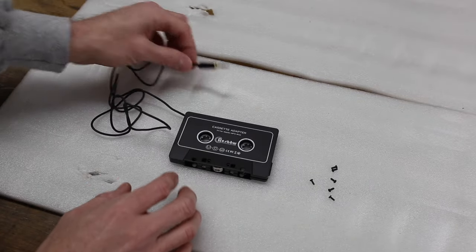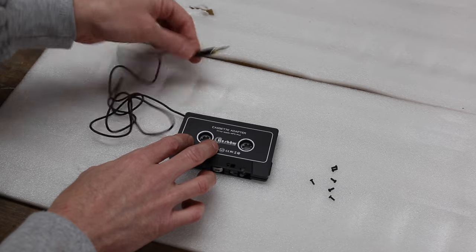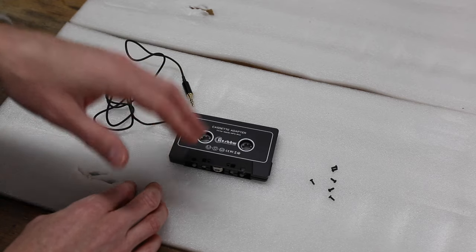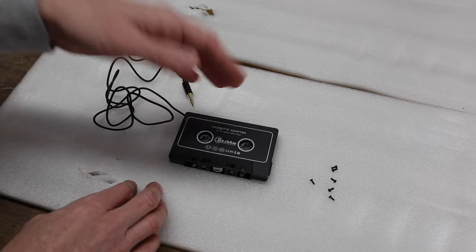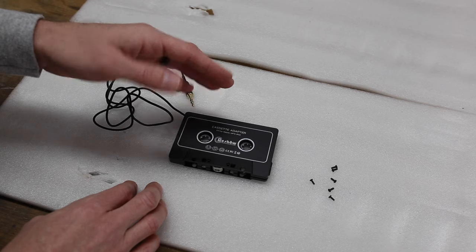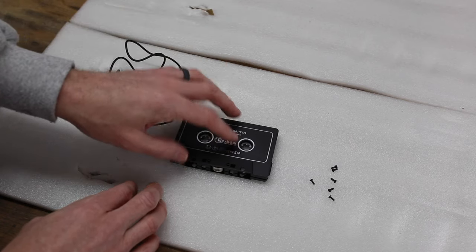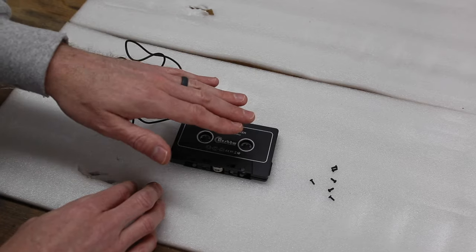What I've got here is a cheap cassette adapter picked up off Amazon — a seven-dollar one with an auxiliary plug input. We're not going to be needing this plug, but I have to have this cassette because the Honda 1000 stereo is an auto-switching input, meaning it won't play the tape input until a tape is actually inserted and playing. So we're going to have to have this inserted — it'll switch over to the tape input, which will allow our Bluetooth to play.